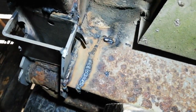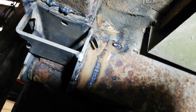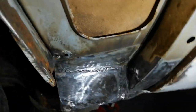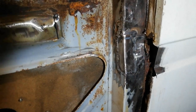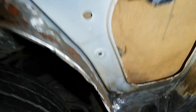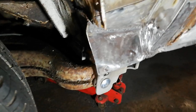So there's the bottom of the sill. The end of the outrigger welded in. Just got the backside a bit left to do now. Got the bottom of that pillar welded in - or post. Got all that cleaned up. A bit up there as well, all done. Not the prettiest things in the world, but at least they're good and strong. And they'll be fine when they're all paddled over and everything.